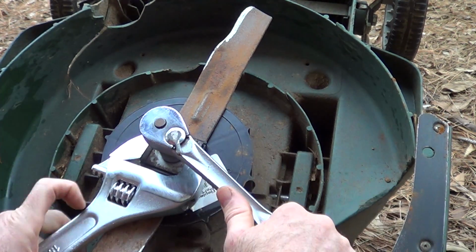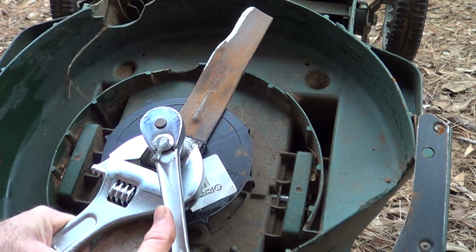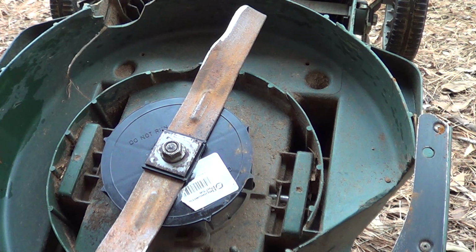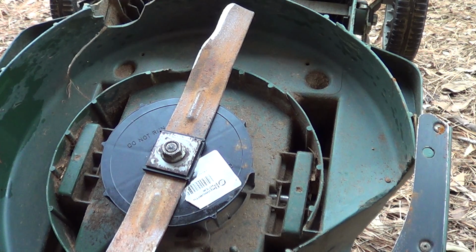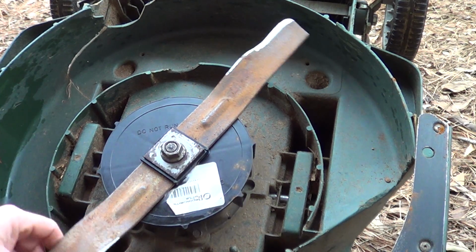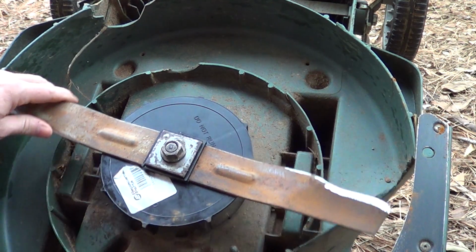Now when I go 100 feet away, this mower draws about 12.5 amps. I use a 100-foot cord. If I'm going to go 200 feet away, if it's not too thin, it'll work. If I'm going to go 300 feet with 12 gauge wire, I've got a variac where I bump the voltage up to about 130 volts. So I've got full power at the motor.